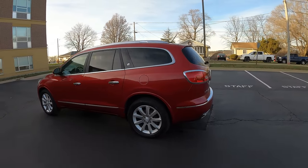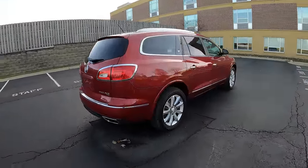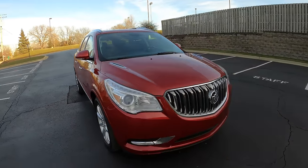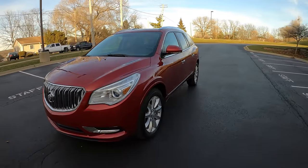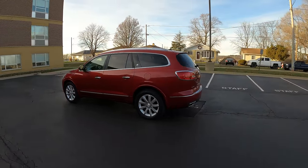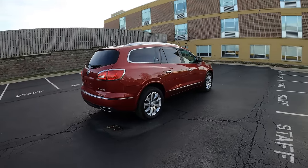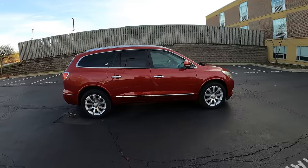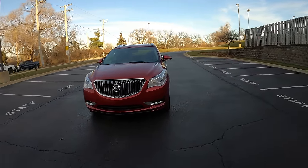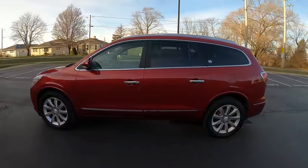Our Enclave is all done — back in one piece, all one color. Part of doing rebuilds and making them profitable is knowing what your parts are going to cost before you even start the rebuild. The subframe was $60, the wheels less than $100, the quarter panels about $200. The most expensive part was the rear bumper and the taillights. The rear bumper is $500. The bumper and taillights fit model years 2013 to 2017, while the quarter panels and subframes fit all the way from 2008 to 2017, so there are a lot more years of availability. When you know what your parts are going to cost and what you're going to sell it for — or at least what your competition is selling for — you can figure out what you need to pay for the car instead of using your emotions. That always leads to overpaying, which seems to be a common problem at the auction these days.